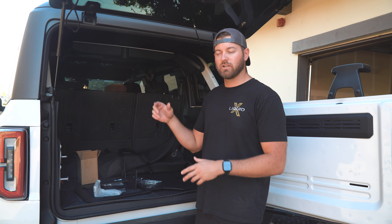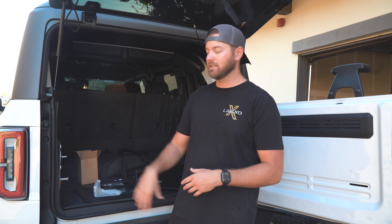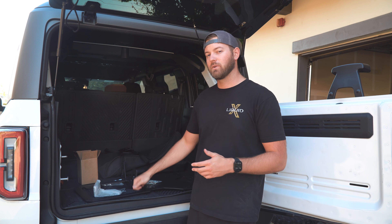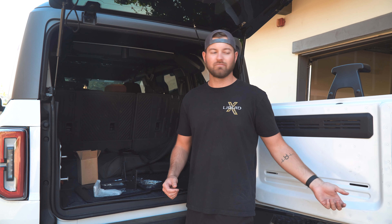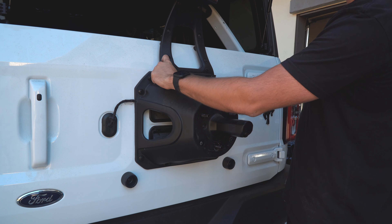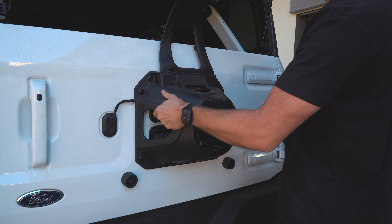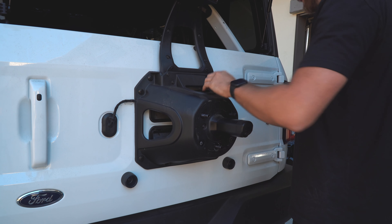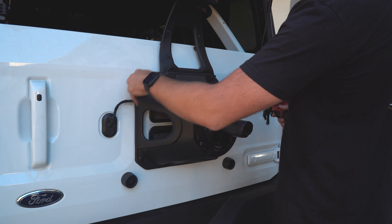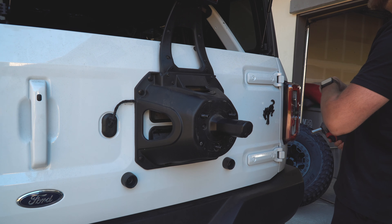The spare tire extension or third brake light extension is sold separately, so I forgot to order that — I'll have to place that order. But with my offset, I'm not hitting the third brake light on the spare tire, so the main thing is adding rigidity to this aluminum door so it doesn't buckle or crease. The next step is taking off the factory spare tire holder, which is actually a composite plastic — pretty surprising that this plastic piece is all that holds the spare tire.